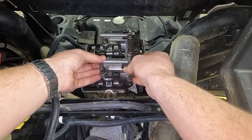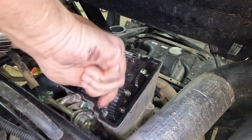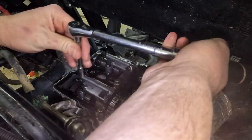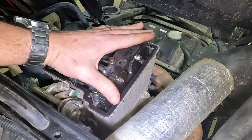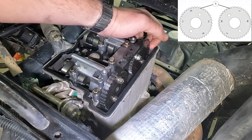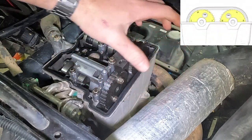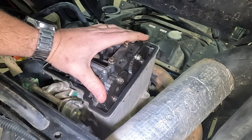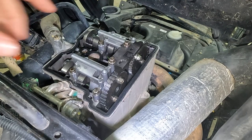Now we need to reinstall our carrier — which was this guy — with our bunch of eight-millimeter bolts. We're going to torque these down to 84 inch-pounds, or seven foot-pounds. Quick little pointer: if you somehow dropped a sprocket and messed up your timing, we're lined up on the side of these — you can see there's a line for exhaust and a line for intake. Just making sure we're top dead center still — those all line up nice and flat, flush with the top of the head. And that's how you set the timing, just in case you accidentally jumped a tooth or want to double-check. That's what we're looking for, and we're good there.